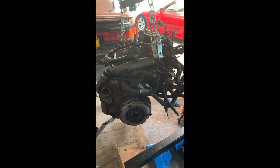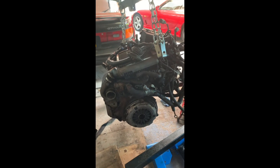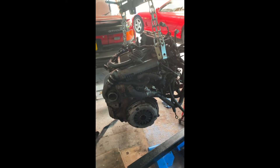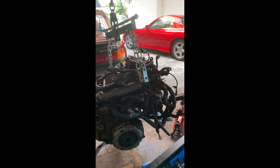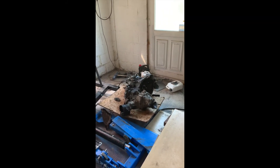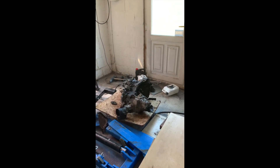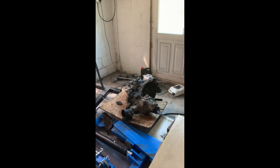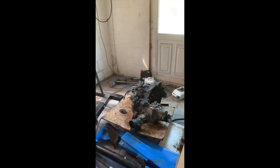So I'm just going to have to wait — I'll get online and figure out if we can get some longer bolts of the same pitch thread. Once we can get it on the engine stand, we can pack away the crane and start cleaning it up, splitting it apart and seeing what's going on. The next move will be to bring the gearbox out and give it a degrease and clean it down. There were no issues with the gearbox — we just had to get it off to do the clutch. Hopefully we'll put a new throwout bearing on, new oil, give it a clean and paint.